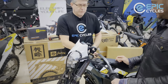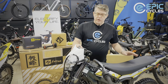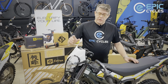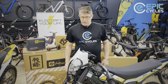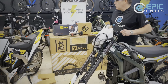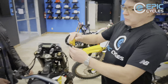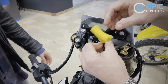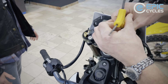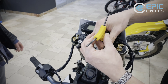At this stage you can do a couple of different things as you assemble. What I'm going to do right now is loosen and set up the handlebars, have everything approximately in position, mount the front wheel — actually mount the front fender first because it's easier to put the fender on before the wheel. Then the wheel goes on. I'm also going to bring a little bit of grease over. So we're going to take off the handlebar clamps. The stainless steel hardware is a nice touch — it'll help from corroding in the future, keeping your bike looking beautiful.